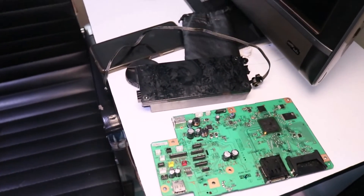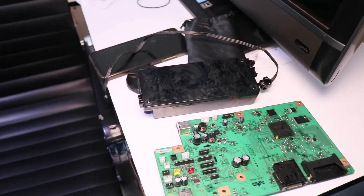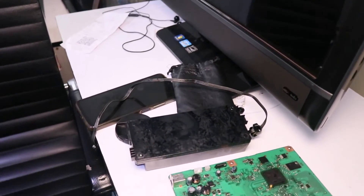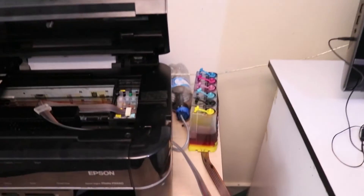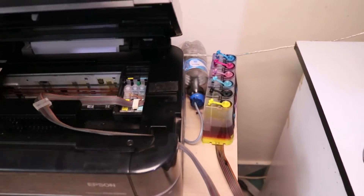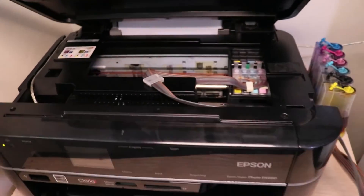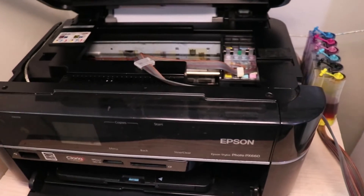As a result of that, I had to replace all of this on my old printer. If you have a new PX660 printer, ensure that you have your waste ink routed outside the printer. These are the ink cartridges for the printer as it comes from the factory, but make sure you have your waste ink going outside. That way, the waste ink will not overflow inside the printer, resulting in the motherboard or any other part of the printer getting damaged by the ink.